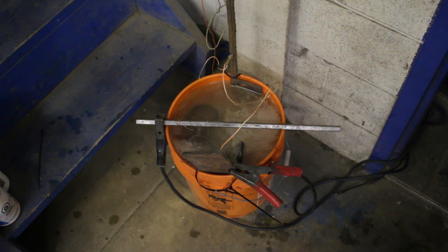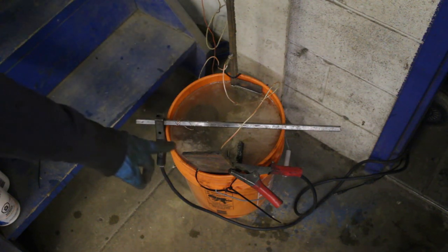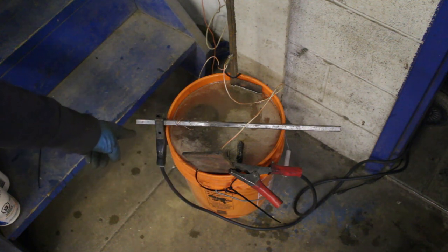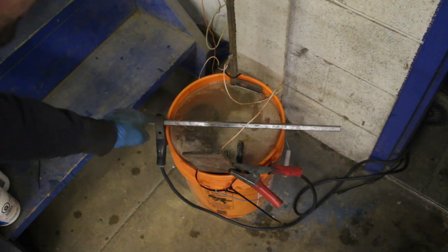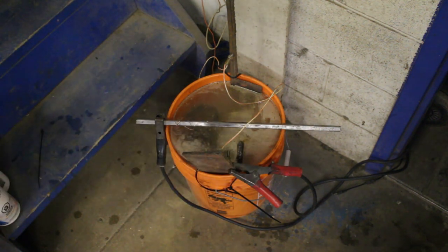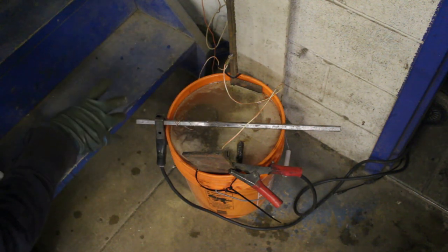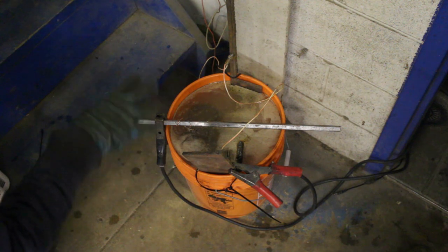The springs are dipped into the bucket, and how this works is you have two sacrificial pieces. These are big chunks of metal. They are connected together with this wire, and the positive terminal from a battery charger is connected to them. The two springs, now you can't see them anymore, but they are hooked up with this wire. And this wire is connected to this bar, and this bar is connected to the negative terminal, of course, of the battery charger. And I made sure the springs inside don't touch the sacrificial pieces, because that's gonna short it. So the only conductive thing between the springs and the sacrificial pieces is the water,